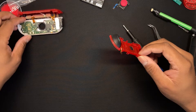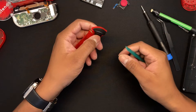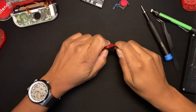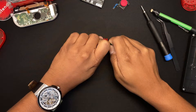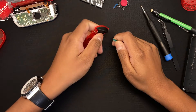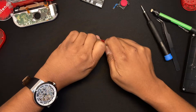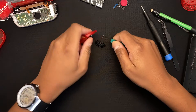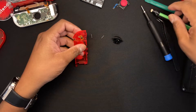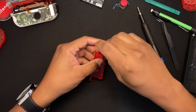Keep your screws organized — it's not too hard for Joy-Cons because there aren't that many. Same thing like the left Joy-Con: stick the button down, then shove the pry tool inside while it's facing down and push down. It's not always easy, but take your time and use a little more force than you think you should, and it should come off.